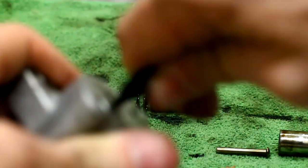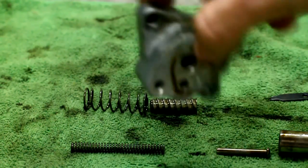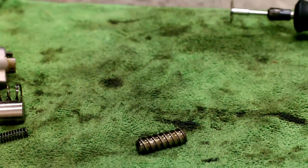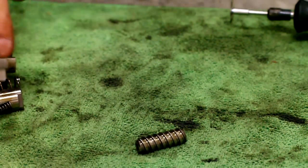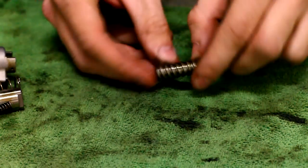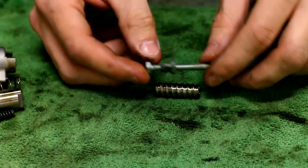I'm just going to use a regular screwdriver. It's very simple — it just unscrews, it's just a plug. You're going to take that out with a flat head. I'm going to go ahead and show you how to do the repair. Once you've got the whole thing apart, set all the other pieces to the side — make sure they don't roll away or anything like that. You'll have the worm drive, which like I said earlier, this is your actual problem here.